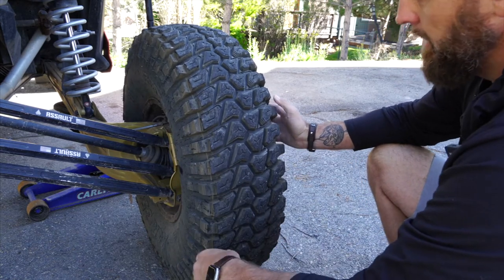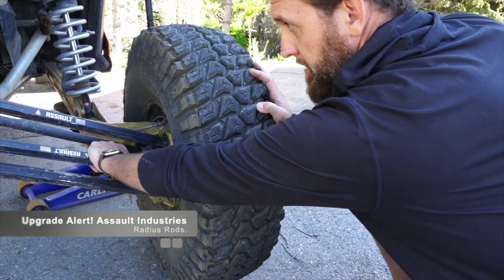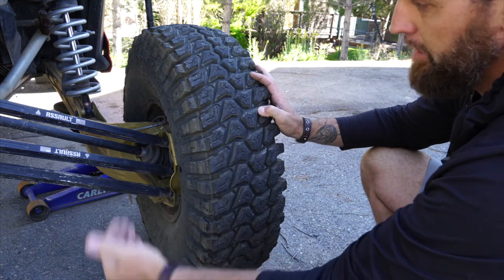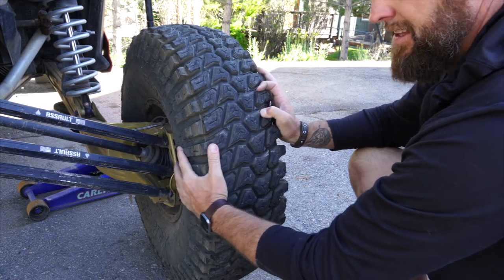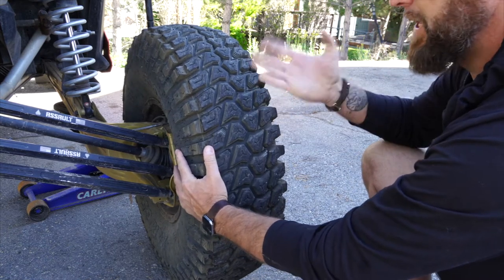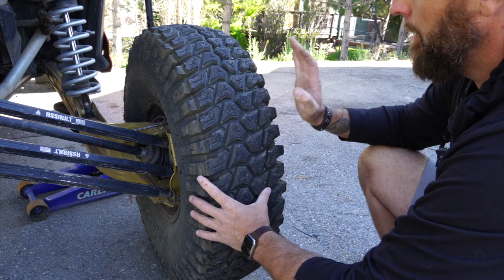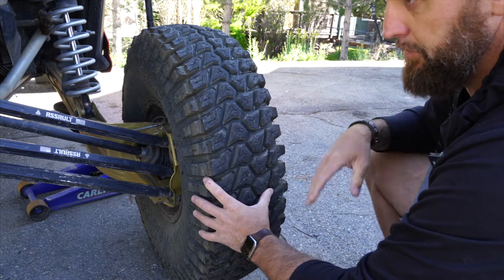One of the things that helped while I was waiting for these knuckles to show up — they were on back order for a long time — was these assault radius rods. I got rid of the super ATVs that I had, and these let me adjust the toe, the camber, everything on the rear to kind of help clean that up. But it was only going to be a matter of time before this thing just sort of snapped. That's unreal to have that much movement. When you're driving down the road or taking a corner, it pitches the vehicle and it's just really super unsafe. I can't stress enough how important it is to check that if you've got one of these machines prior to 2022 and you haven't upgraded the rear knuckles — that's going to be a real problem for you. So just plan on doing an upgrade.